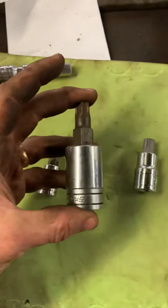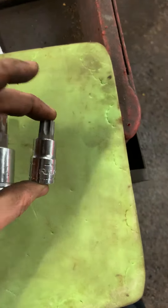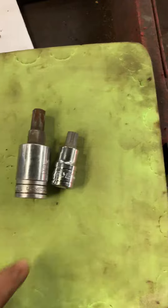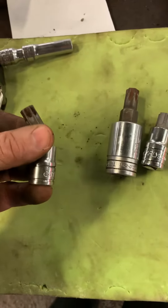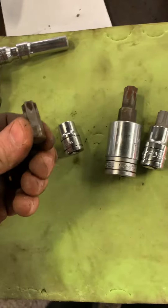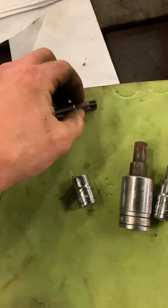This is a snap-on T60. That's a Napa Carlisle T60. None of those worked — they both hit the tone ring. What I did was I took a Carlisle Napa T55 and removed the bit, then I took a 12 millimeter socket and put it right in there.